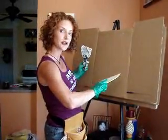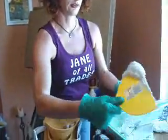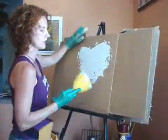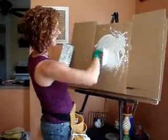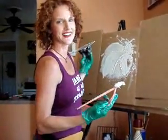You're going to want to start with the bigger one to spread in the bigger spaces on your wall, and smaller ones to get the smaller corner spaces. You're also going to need a notch trowel — notch size depends on what effect you want. If you want a deeper, bigger ridge, get a bigger wider tooth notch; or a smaller one. I'm going to show you a quick little sample. Scoop out the plaster, spread it on — you want it kind of thick. When it's on the wall, it's okay if there are spaces missing. Take the trowel and make a rainbow effect, overlap it, just kind of work with it. It really is simple — try it at home! Here's the finished effect; this is what it will look like. Fabulous.